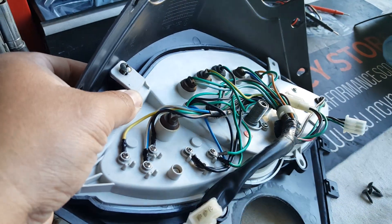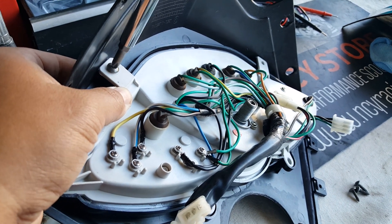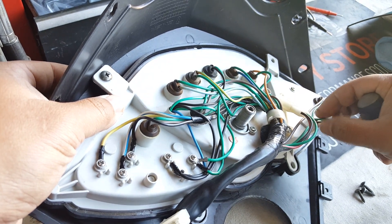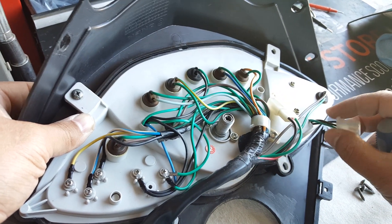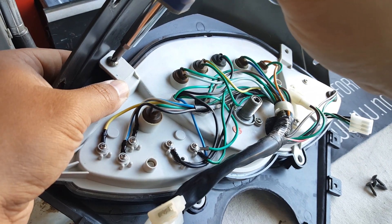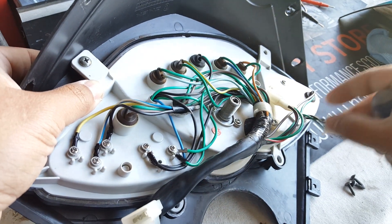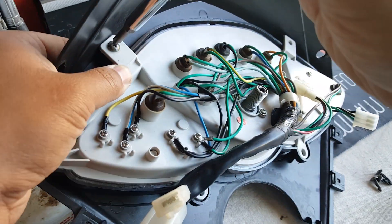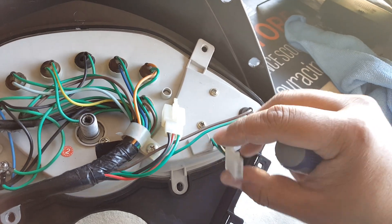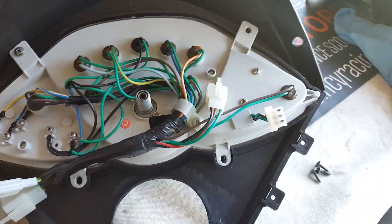Into our harness there, I'll probably put some silicone here to have a little bit more grip, just to seal the hole because I don't want to put a lot of strain on the solder area. Once we get this on, we're gonna touch it up with silicone afterwards — if we put silicone right now we'd be moving the wire around a lot, creating a mess. We'll pump some silicone in to seal the little opening marks, and when it dries it gives a little hip brace so it won't yank out.